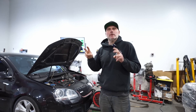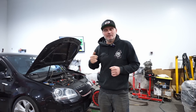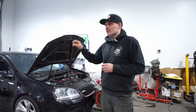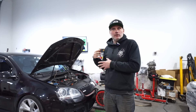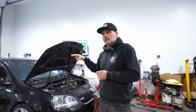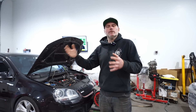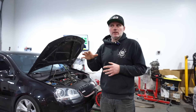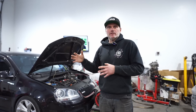We're tuning with Eurodyne Maestro 7 — it's considered just Maestro nowadays, but it originally was called Maestro 7 because the ME7.0 is used. We're going to do a base run first at 337 to make sure all is good, since last time we had to fix some stuff. We'll do a baseline to see where it sits today, then start playing with timing, and hopefully reach the goal of 400 wheel horsepower. The water meth should definitely help at 25 pounds of boost.